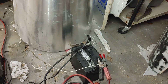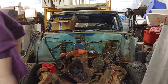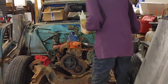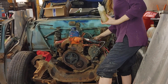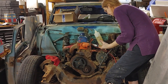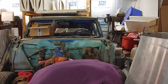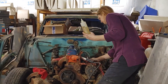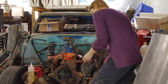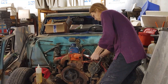You're going to start this? Let's see what happens. It's going to get really smoky in here — well, if it actually starts it will. I set the juice down again. Put the juice down, let's see what happens. Be brave. That's not much crank. Give it 50. How much compression? Well, it was cranking without the plugs in it — so there's the problem.